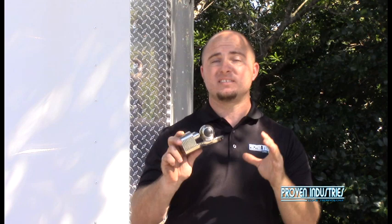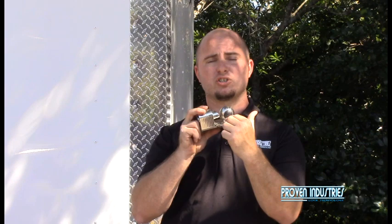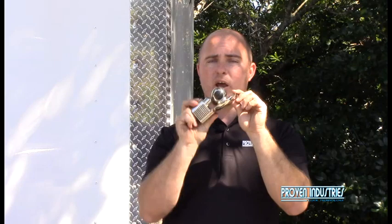Now let's go over why this product failed on us today. It's also made of a cheap die cast material, but zinc, which is not a good material to use. Manufacturers like to use it because it is cheap and it does keep production costs lower. But unfortunately, it's not a good combination for security products. As you can see in the video where I demonstrated, I put a pry bar right above here, put a little bit of leverage on it, and it caused the whole base of it to crack. Once that crack was introduced, it allowed it to come right off the coupler, and at that point it's not serving a purpose and it's not protecting your trailer. So unfortunately, the materials contributed to this product failing today.